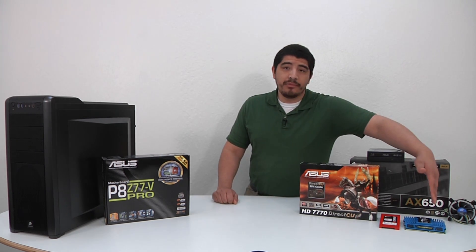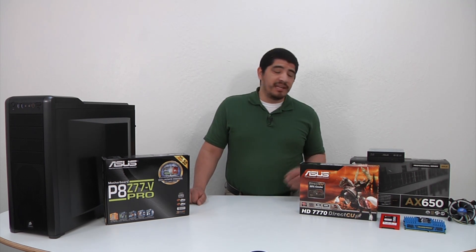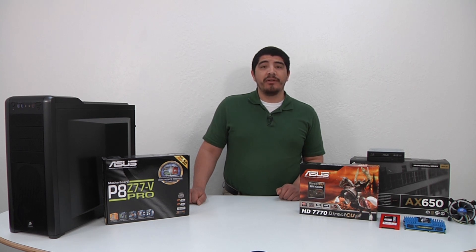In terms of memory, we've got Corsair Vengeance Blue memory — four-gigabyte DIMMs for a total of 16 gigabytes. This gives us a lot of flexibility and a really long lifespan. For about 90% of users, we're never going to exceed this amount. It's rated at 1600MHz, giving us higher performance than the default 1333 memory. Having 16 gigabytes also gives flexibility for cool things like RAM disks or RAM caches to increase performance even further beyond the fast CPU and SSD.